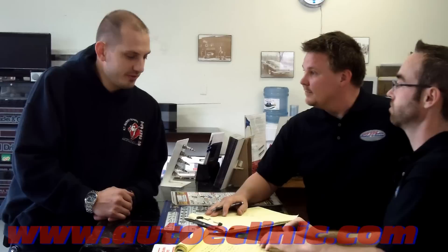Hey guys, what did you find out for me? Hey Chris, we did confirm the noise you heard was coming from the left front wheel bearing, but also during the visual inspection, we found your left axle boot to be busted. Oh really? It's going to be a lot cheaper, Chris, if we replace the axle while we replace the bearing. We can definitely save you some money on labor replacing both items at one time. That makes sense. Well guys, I really appreciate it. That sounds great to me, let's go ahead and get that fixed.